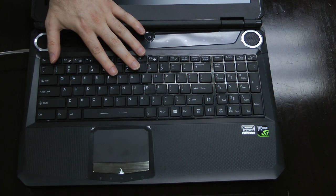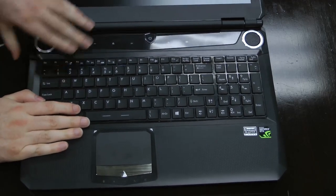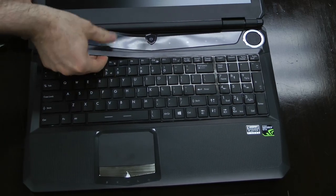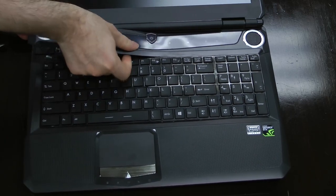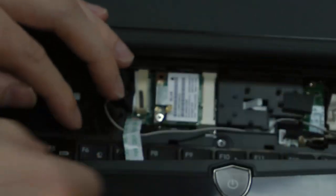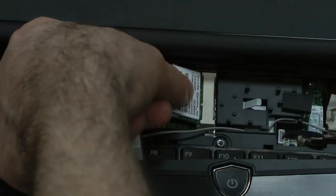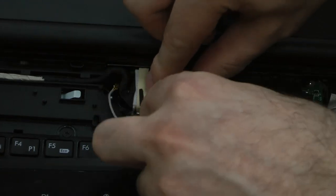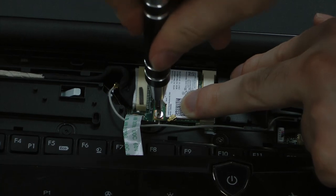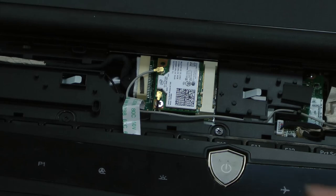Replacing the Wi-Fi and installing the other two DIMMs is a more complicated task. Start by wedging a flat-head screwdriver under the side of the top panel. Very gently pry it up and slowly snap it out, popping open the plastic snaps from left to right. Next, disconnect the two antenna cables attached to the Wi-Fi card, then unscrew the retaining screw holding the card in place. Tilt it up and slide it out. Then tilt the new card into the slot and push it down, then reinstall the retaining screw. Reconnect the antenna headers to the new card the same way they had been connected to the old one.